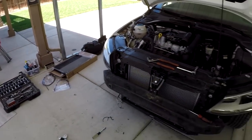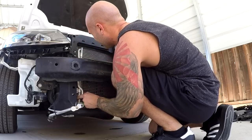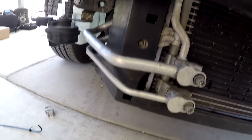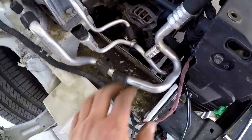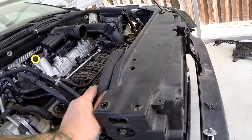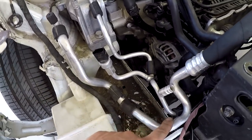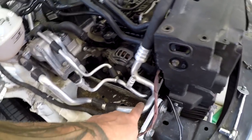After a bunch of wrestling and bending these AC lines back into place — I don't have another vehicle to reference right in front of me — they're a little bit out of place but at least they're not rubbing or touching anything. The kink is now gone and it's going to sit below the hood line. This thing had been bent so out of proportion. These AC lines can be $300 to $500 to replace all the way back to the firewall, so I really don't want to over-bend them.